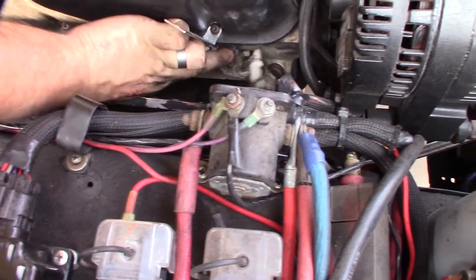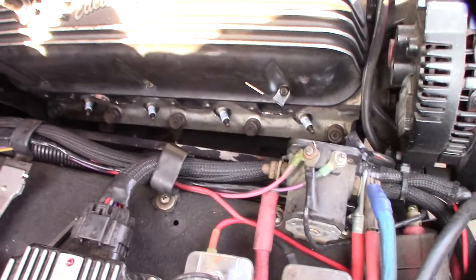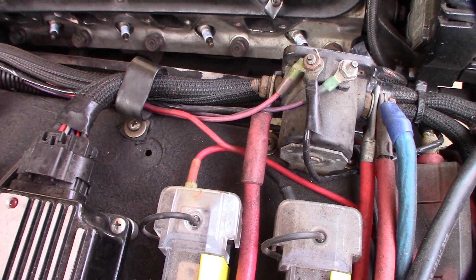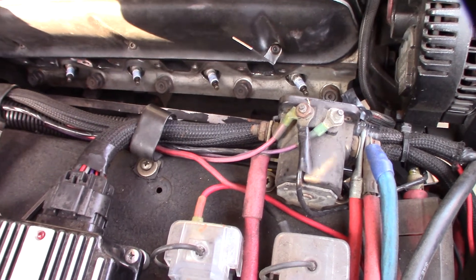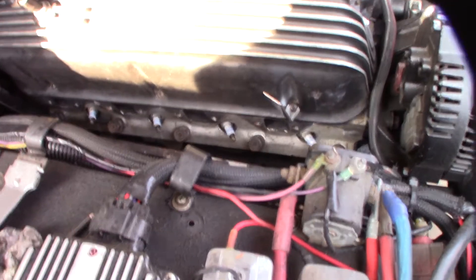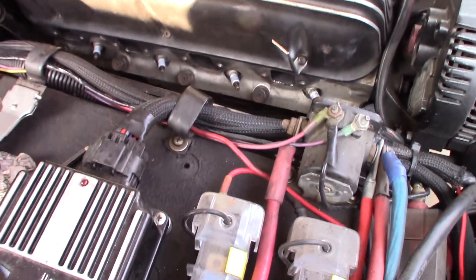I used a little acetone and rubbed every surface down to get anything possibly raised off of there — I want it shiny. These are Edelbrock heads, by the way. I tried Pro Comp heads over the years — this is my third 351 on this car, originally a 289. Pro Comp heads were problematic; the holes are usually offset and not drilled or tapped correctly for the roller rockers. Nothing seems to line up right. The Edelbrock heads lined up perfectly right out of the box.